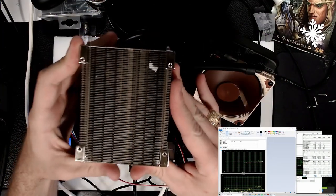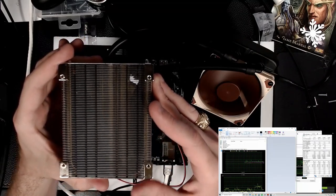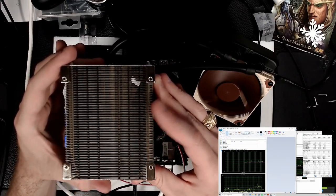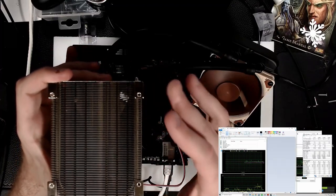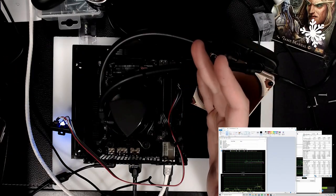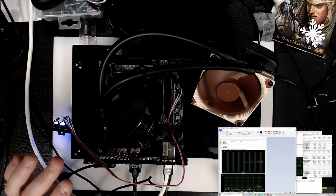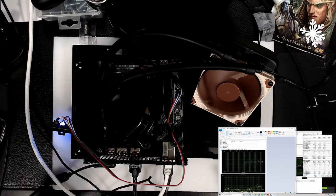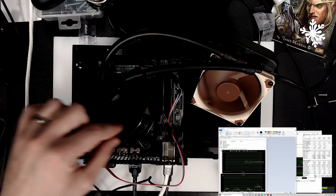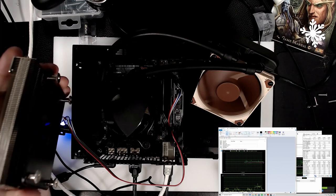Here's the problems I have. If we go with the Noctua cooler, it's not as sexy. Honestly, the 3 or 4 degrees that we were seeing in addition with the Noctua cooler is not a bad scenario. The bad parts for this build is for high CPU load scenarios, the heat is all focused on this motherboard and we smell the epoxy starting to heat up. But on the flip side, the airflow is great. The Noctua downdraft air is pushing air onto our NVMe drive a little bit, onto our VREGs, onto our DIMMs. So it's like the Noctua cooler satisfies most of the stuff.